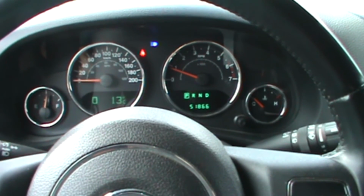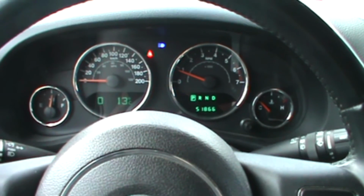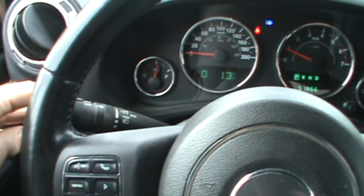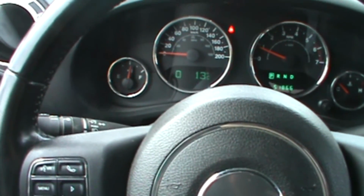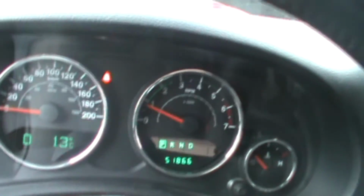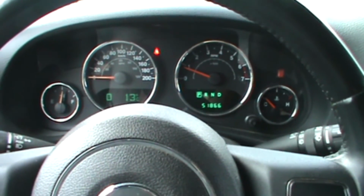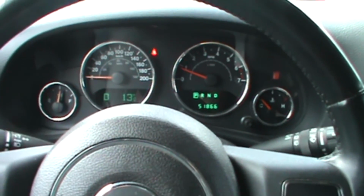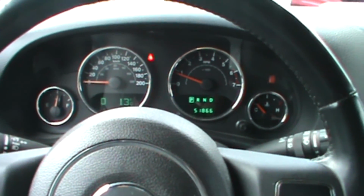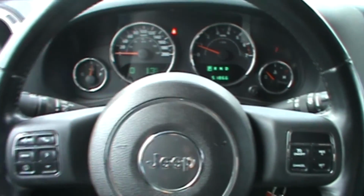That's it. So your center is now programmed, but you have to exit properly by pressing the flasher either to the left or the right position. There you go. You heard two beeps of the horn. That means the operation has been successful, and then you can pull your chip out of the hub and you're done. Your steering wheel is now completely centered, as you can see.